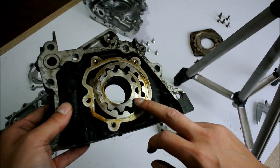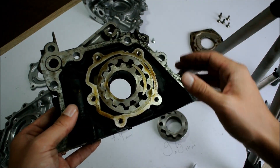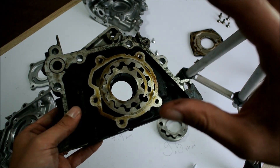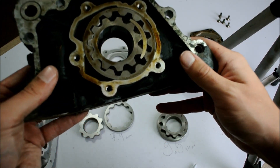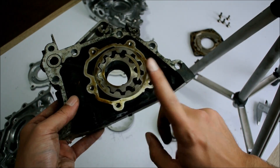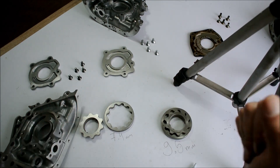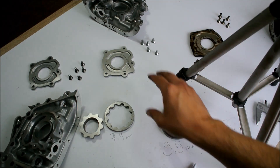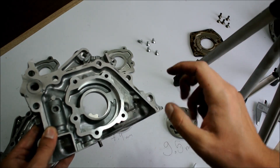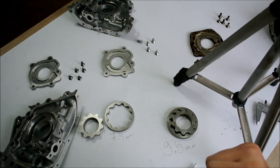This original design you will be very hard pressed to find if you buy a brand new oil pump, because this design was dismissed relatively early on. You will only get it new if you find some very old stock that has been sitting on shelves for decades — so you'd actually be unlucky to get this one. What you might get is the thinner one, as I just did, but you want the thicker one. There are actually a couple of stores that sell the thicker design and will guarantee you get the thickest gears — there are links to these stores in the video description. That's also a really good way to ensure you get the right oil pump for your 4G engine.